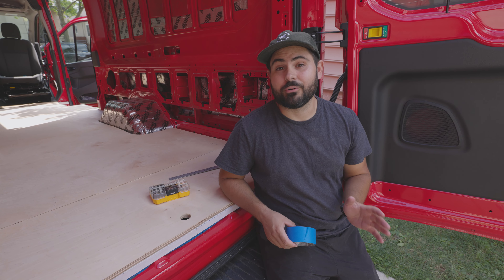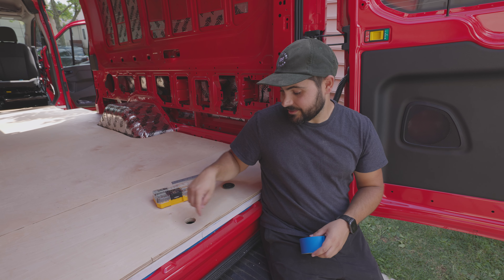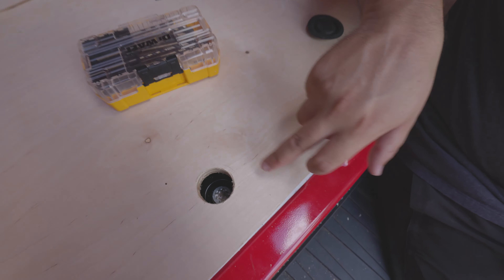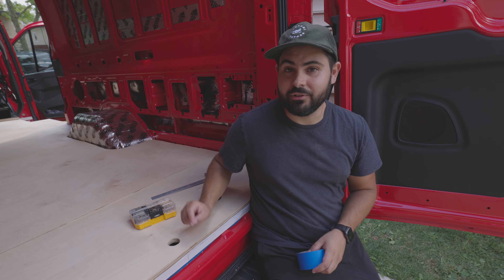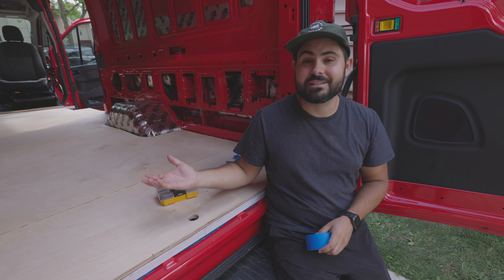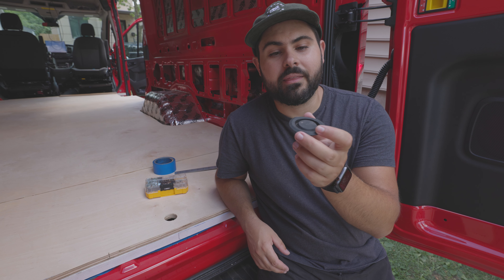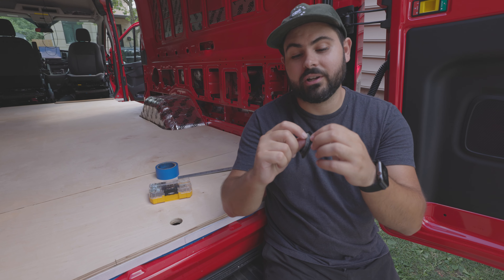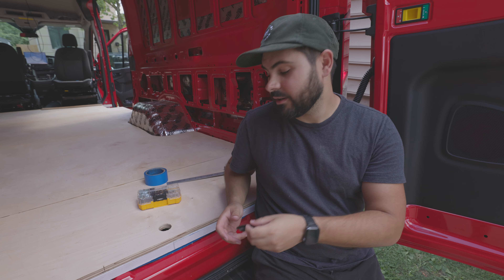This is really important if you have a Ford Transit: at the rear of your van, there is a bolt on the back by the tailgate down there. You need to have access to that no matter what you do, because that is the only way you can drop your spare tire, which is mounted underneath your Transit. Ours was covered, so we're going to find something else to fit into here instead of using wood for that mount.